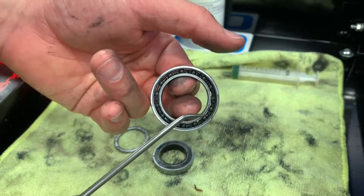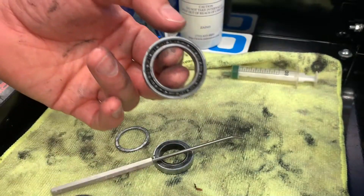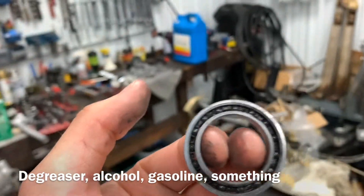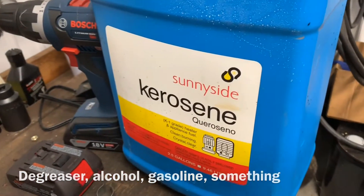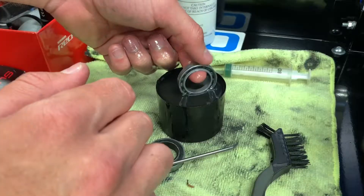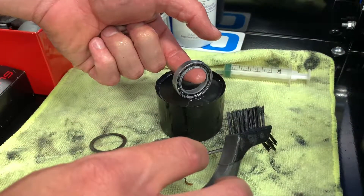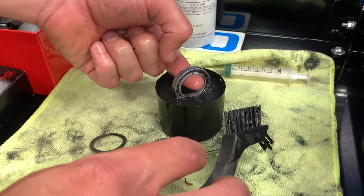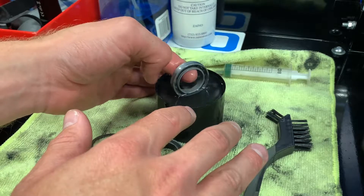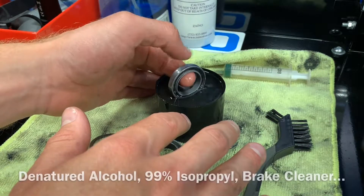So how do you go about cleaning this? Our goal is to remove as much dirt, corrosion, and old grease as possible, and what you really need is a cleaner. There's a lot of stuff you could use — I'm using kerosene, which is more or less diesel fuel. I'm trying to flush out whatever sand and grit has worked its way in there. You probably shouldn't be getting the cleaning agent on your skin. Use whatever cleaner you want — maybe chain cleaner or something similar.